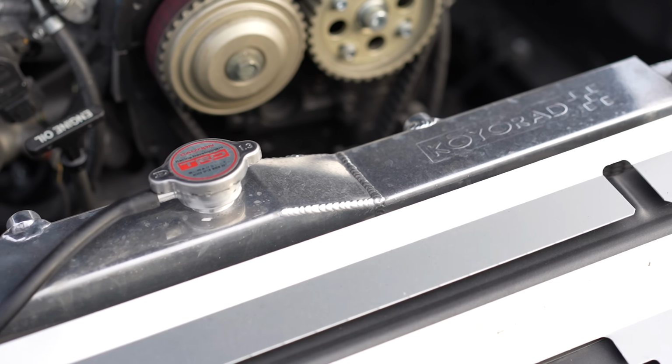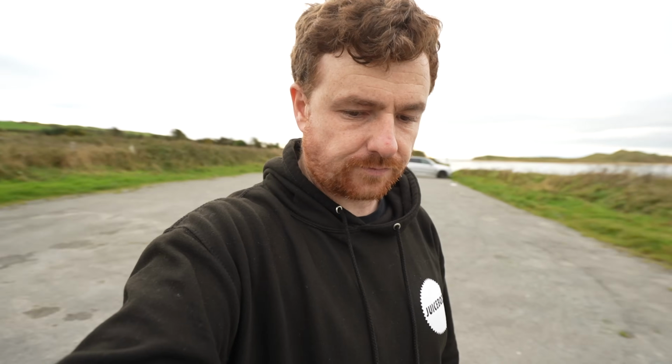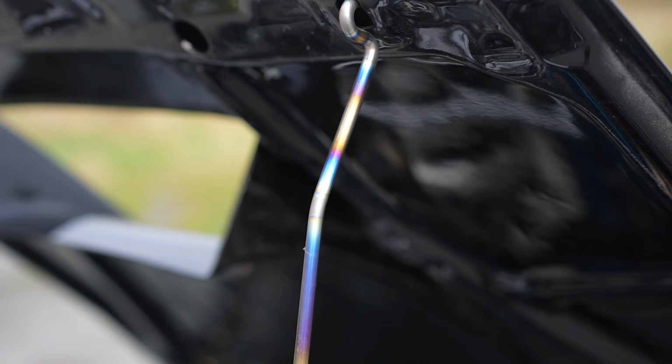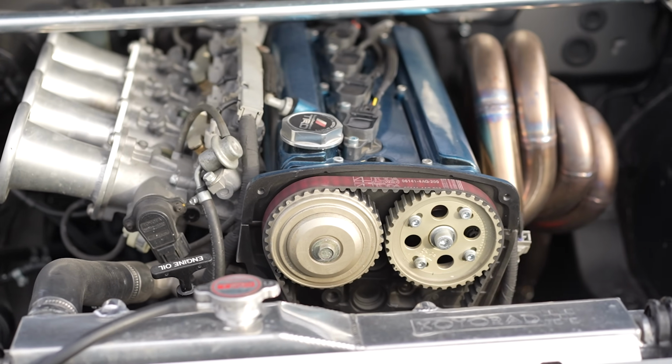It's crazy. I think we used Spiori's valve stem seals on the head because it was Dougie's other head, he'd built it. So the engine is actually drinking a lot of oil, and it's quite smoky. Not super smoky, but you can smell it. So we may potentially have to take the head off and inspect down the line. I think part of it as well was we built a fresh engine, and then I was just driving it in and out of the spray booth, and I didn't really bed it in properly. So it's either not bedding in, or it's the valve stem seals.